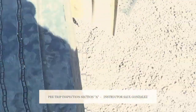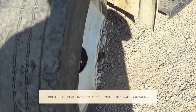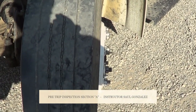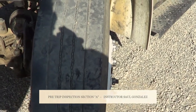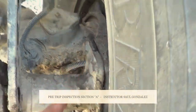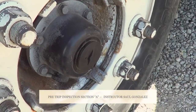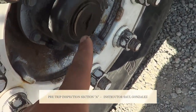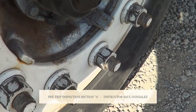From there, I'm going to start inspecting the tire. The tire in every single pre-trip is very important — if you're missing something in the tire, most likely you will fail. Every single pre-trip has a tire, so we're going to inspect the front tire. I'm going to point to the inside hub seal and outside hub seal. I'm going to make sure there's no crack, broken, or leaking, and it's securely mounted, no missing hardware. If it was leaking, I will see puddle or spin trail. The cap for my hub seal is not cracked, broken, or leaking, and it's in the locked position.